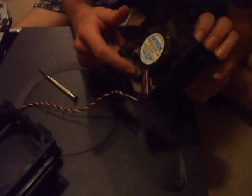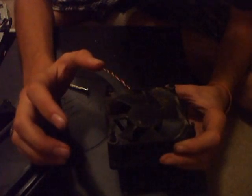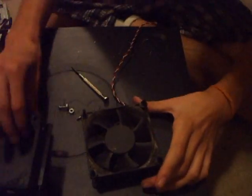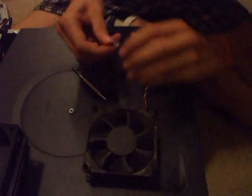The Daytech fan — which most people call it in the Dell — was getting replaced because they thought the source of the rattling was from the actual fan, which it wasn't. It was from the way that Dell mounted the actual fan in the computer, with just a clip-in kind of thing, and not actually bolting it to the case, which allowed it to rattle over time. To fix this, we're simply going to use the existing bolt holes on the fan, on the outer casing, and on the outside of the case itself, and do what Dell should have done from the start — bolt the fan straight to the case. It's going to be a little tricky because of the extra stuff Dell has going on. You're going to run one of your bolts through one corner, and another one through the other, like so.